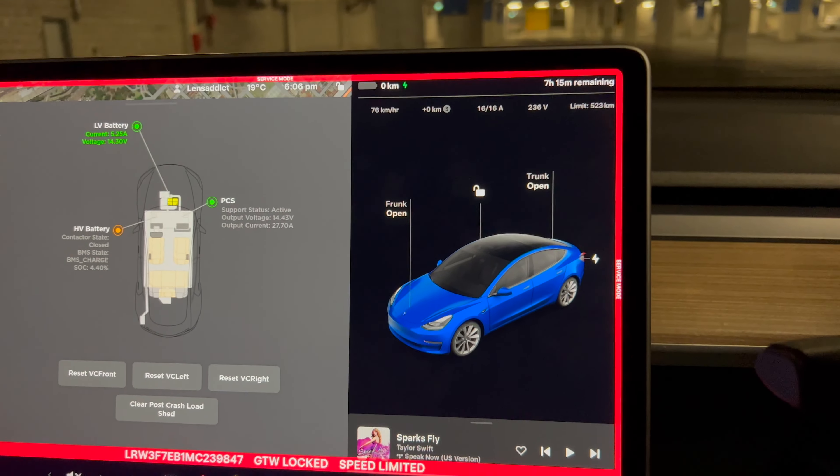That was really interesting. When the Tesla got to a low state of charge, it started behaving very strangely — no power when you floored it. It was like the accelerator pedal: the first quarter did something and then the rest of the way did nothing. The power delivery was very juddery, as if it were an engine stalling. Eventually it started throwing warnings — stop, pull over now, stop immediately — with flashing red lights and beeping. It pretty much put the car in park on its own and refused to go out of park. It drove about 20km after the low battery warning.